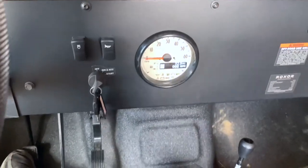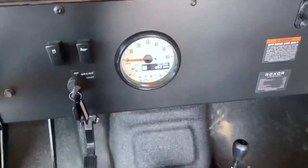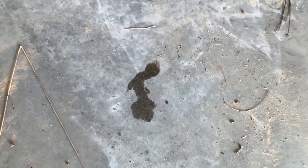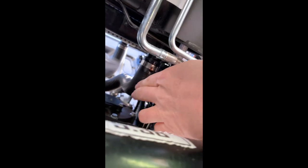We'll sit here in neutral with the parking brake on and we will come back and drain this. While I was letting the vehicle warm up I backed it out and rotated it around. I was checking and there's some liquid on the floor — that is radiator fluid coming out. I'll show you underneath. You can clearly see where radiator fluid is coming out here. After I get the oil change done, I'll loosen this clamp, push the hose back further, and reclamp it to fix the issue.